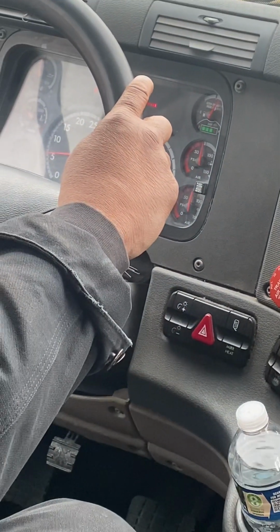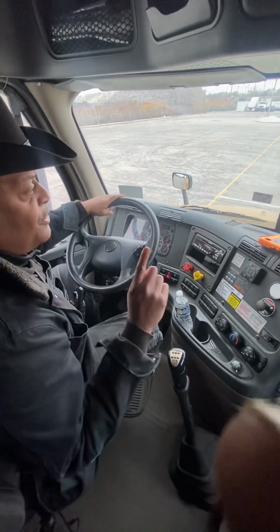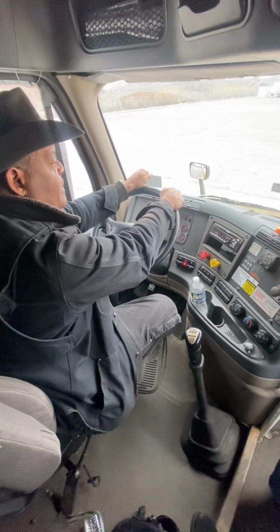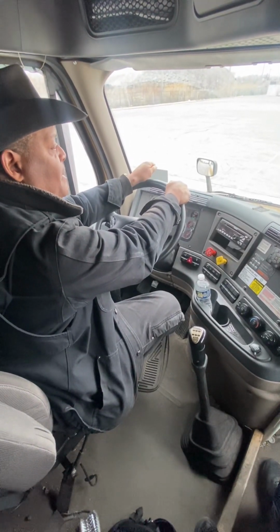All right, so the first portion of the test was our brake check. Now we're just going to check all our in-cabin items. First thing we're going to talk about is our fire extinguisher. It should be properly mounted, secured in its bracket, fully charged to a minimum of 10 BC. It should have an up-to-date safety sticker, and the safety pin should be in place.